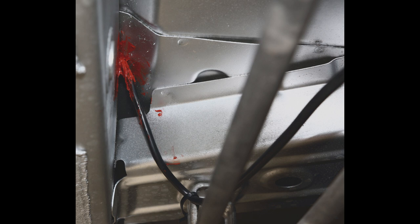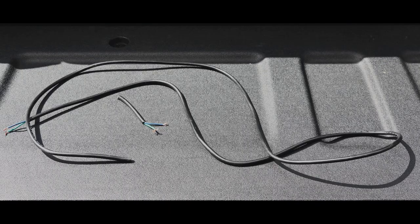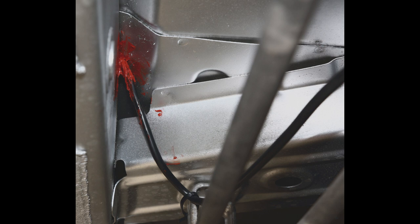eTrailer proposes a wiring route to connect the PopLock to the native Ridgeline wiring. I found that drilling a 3/8-inch hole in the floor about mid-driver-side passenger's door allows a very simple path for the wire into the cabin and avoids the cramped installation through the firewall. It also allows the removal of 76 inches of wire from the installation. A little RTV easily plugs and cushions the wire in the hole.